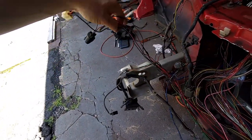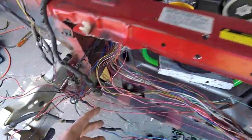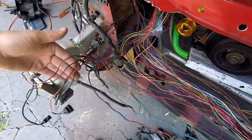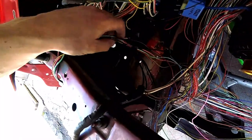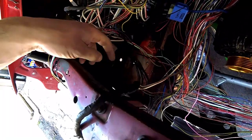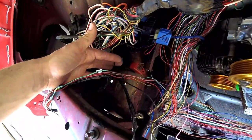I think what I'm going to do is cut the wires at the lights and number the wires. That way I can fish everything back and just splice in new wires from wherever inside it ends up to the headlight wires. These red wires go this way into the car. If I cut them here and number them, I know exactly which is which. The grounds all connect right here, so all I have to do is cut the one that goes to the fuse box and reground it later.